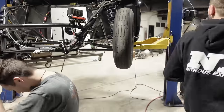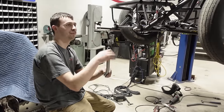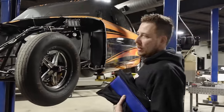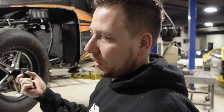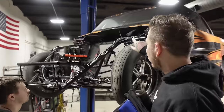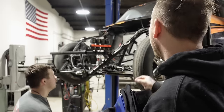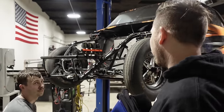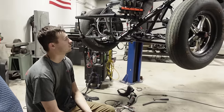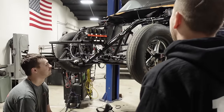Tony's going to send it that way. It's just a lot. I'm going to have to remake this one because as I close that gap up and sweep this forward to close up the gap — your side looks nice. It had a mid-plate in it before, only an eighth-inch thick mid-plate, which is not near enough for the kind of horsepower that Tony has. It also had a Chevy bolt pattern mid-plate. Now it actually has the hemi bolt pattern, the correct one, the thicker plate, all that stuff. It'd be way stronger. We've got tubes going on each side that are tied into the frame, so it'll be a lot more stout. The firewall is literally ripping out of it, so we'll fix that.